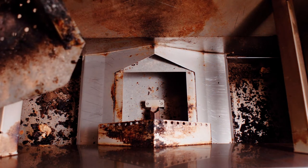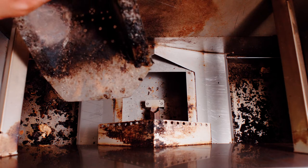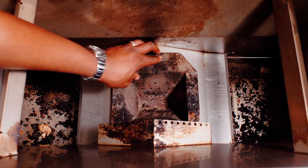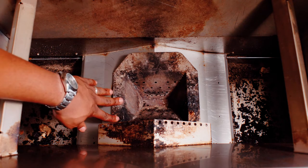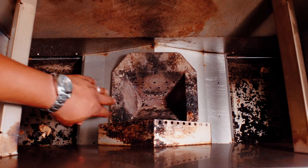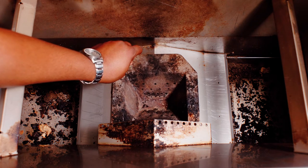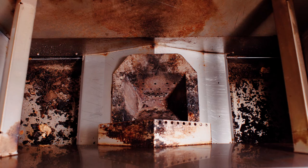Once the inside of the grill is clean and the lower heat shield is clean, you can go ahead and reinstall the burner pot. When you put the burner pot in place, you want to make sure it sits flush. If you're able to wobble your burner pot, it's not seated properly — simply lift the rear, it'll drop into place, and it's seated properly at that point.